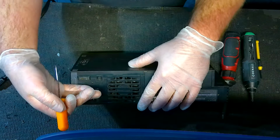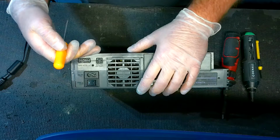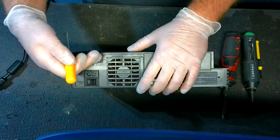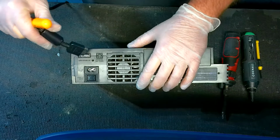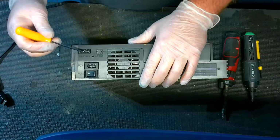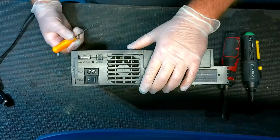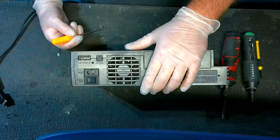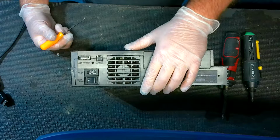And what you're doing is you're prying them downwards a little bit. Now, as you pry them downwards, they're going to put more pressure on your AV cable, and it's going to allow it to make the proper connection. When these consoles are brand new out of the box, we're essentially just making it how it was when it came brand new out of the box. This isn't anything where it's going to damage anything. We're just trying to get it back to how it was.